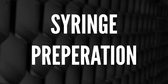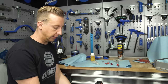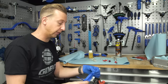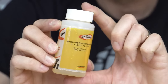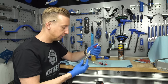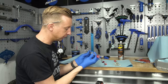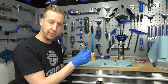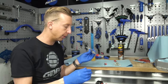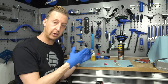The next stage is to get the syringes ready. This is where the rubber gloves come in, so I do recommend you use them. The first syringe you want to fill up with fluid is the one that goes into the lever at the top of the bike — the one with the old style cap on the end — and you want to fill this approximately two thirds full. The next one is the one with the bleeding edge adapter, which I'm just installing here. This only needs a marginal amount of fluid because it connects to the caliper itself and you don't want any chance of air getting in, but you're bleeding from the lever end to this end so you need as much room as possible for the oil to come through.